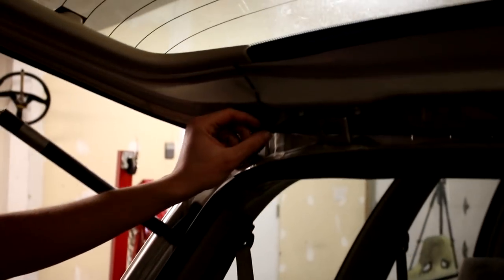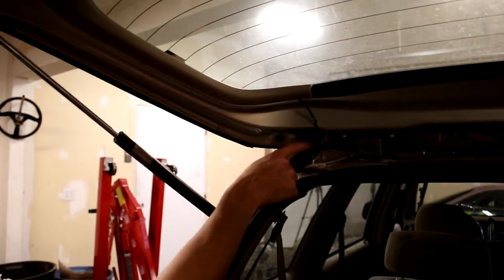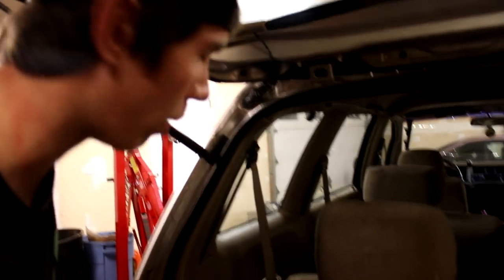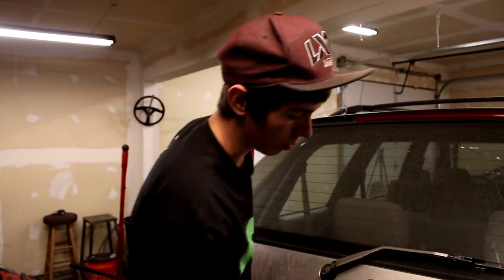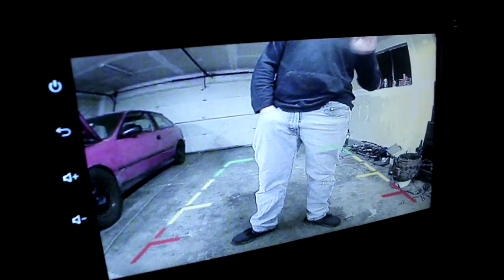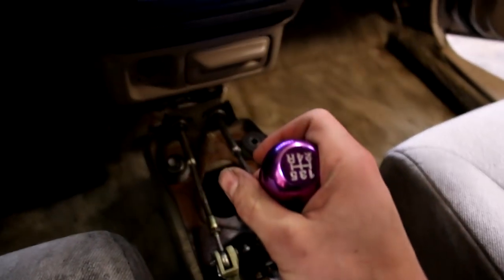I got the wires ran through right here. This is as clean as I could get it because there's no way to run it through this little harness right here — it's all seam welded together, so there's no way to really get to that, at least not that I could tell. So it still looks good. I ran the wires all the way through — up through the trim on top, and by the time it gets to the passenger door it goes down on the little foot panel and then up behind the radio. Big thanks to Brent because without having the reverse lights working, I would not have been able to wire that in. We got the radio right here — if we put her in reverse, it goes to the rear view camera. We got Jeremy back there. It works good. Then when we pop it out of gear, the rear view camera stops working.